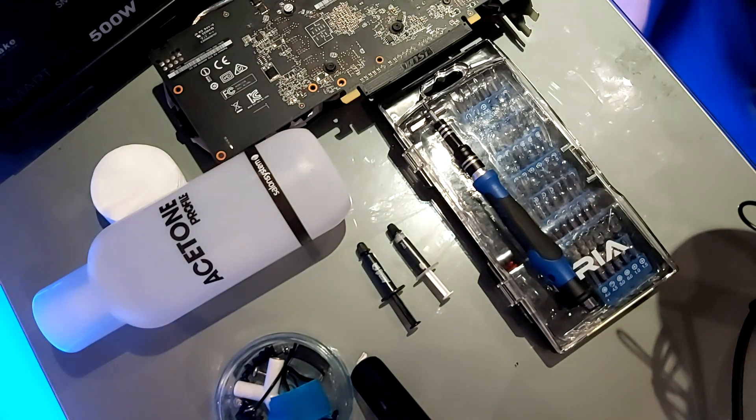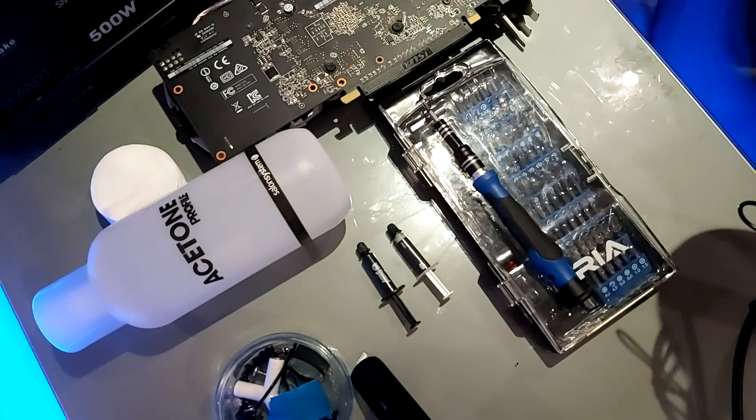The final product you need is some sort of thermal paste. I've got two brands here: Thermal Grizzly Kryonaut and Cooler Master MasterGel. I would highly recommend investing in Thermal Grizzly as it provides 12.5 watts per metre Kelvin compared to MasterGel at 8 watts per metre Kelvin — the higher the value, the higher the grade quality of materials used in the paste.